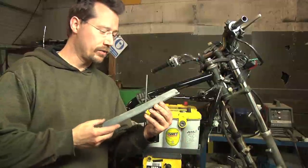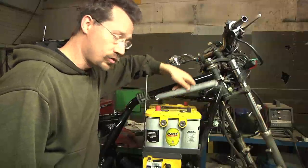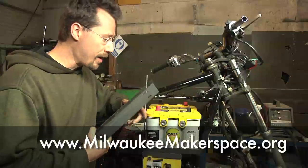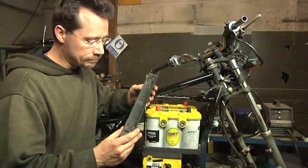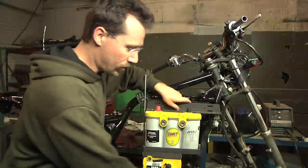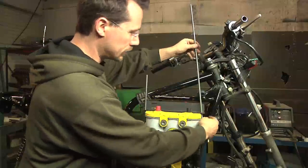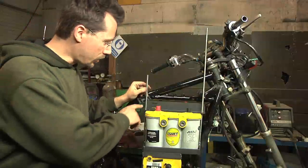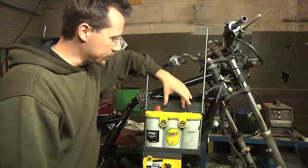I was thinking I'd just use a piece of angle iron as the top tie-down, pressed down with some threaded rod, but that was my last piece and I need two. Instead, I found here at Milwaukee Makerspace in the scrap metal pile a whole bunch of these brackets originally used for holding computers. It's already powder coated, it's got slots and holes, and it's just about the right size. I took one, cut it to length, put a couple of holes in it, added washers and nuts, and cut the rod off. Now I've got a very nice, economical battery tie-down.